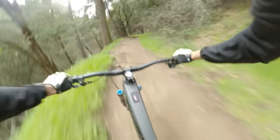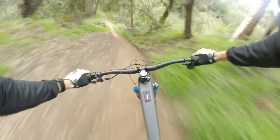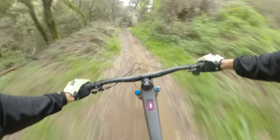And I don't think there's a need to try and come back to this light SL, just embrace the fact that it's a freeride bike and let her eat, because that's what it wants to do. Yeah. To go back to frame details, like the stiffness, it's got a straight 1.5 head tube, which is really cool. A pretty sizable, I mean, what would be a BB area, down tube, seat tube junction, whatever you want to call it, super stiff rocker link.